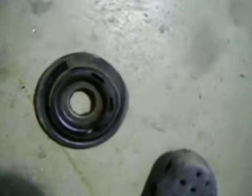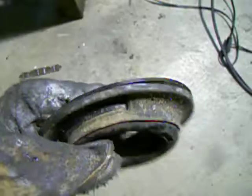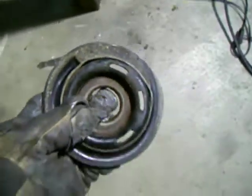And there's an equivalent groove. It's less pronounced, but in the top, I'll show you. You can actually just look at your old one and see the dirt mark, and you can tell where it went. The top of the spring goes right there. So anyway, make sure you get the spring lined up with both the top and bottom parts of the strut.